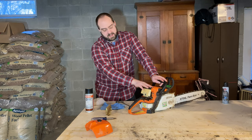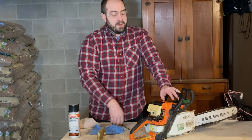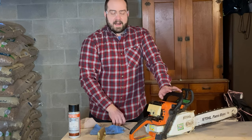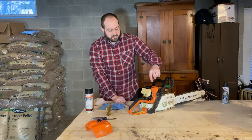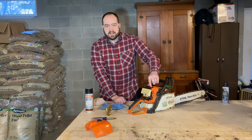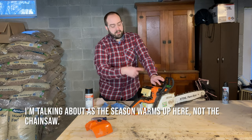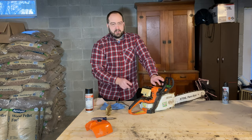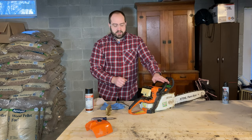The mesh side down with the snowflake facing up allows that warmer air to recirculate back through the chainsaw and stay warmer in those cold weather temperatures. I can't believe I've been doing that wrong this whole time — I was flipping the pre-filter around and maybe that still helps, maybe some of the heat still passed through. I never had any trouble in the wintertime. But I did learn after reading the manual 18 years later that you're also supposed to rotate that piece underneath the spark plug boot to allow that square to be open in the winter time. Now you want to make sure as it warms up, you flip that back over so that you're not overheating your saw — you would never want all that heat on a hot day recirculating and causing an overheat situation.